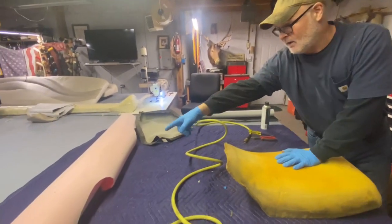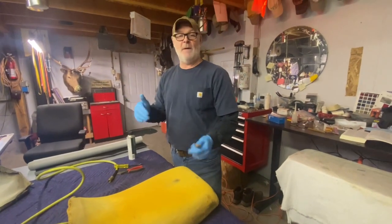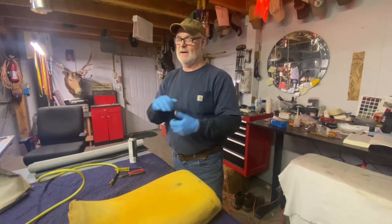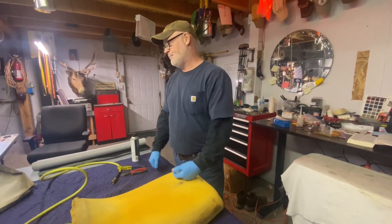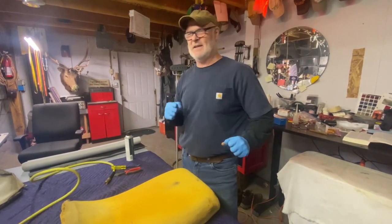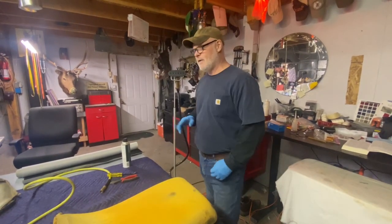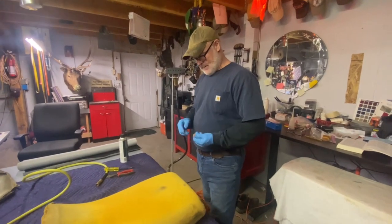Come this way. There we go. Quarter inch scrim. That's your topper. It doesn't have to be scrim, but use scrim. I recommend scrim because of the backing that's on it, that mesh backing that gives it a rigidity, and it's a better product. You know, get in where you fit in. You might not have scrim, but okay.